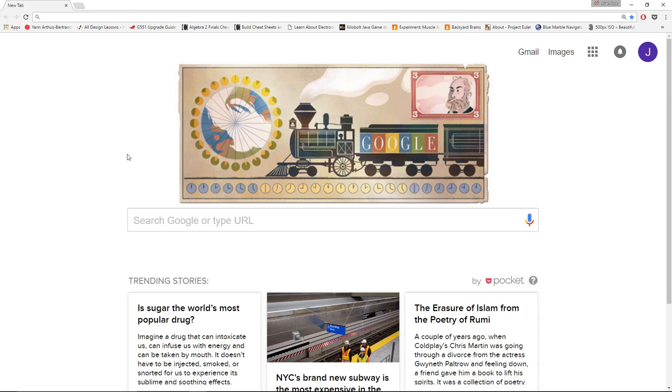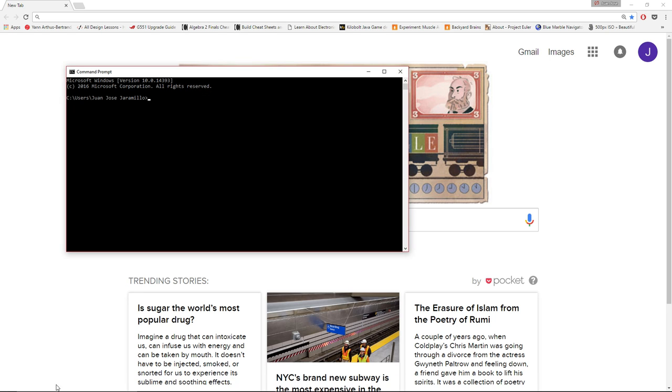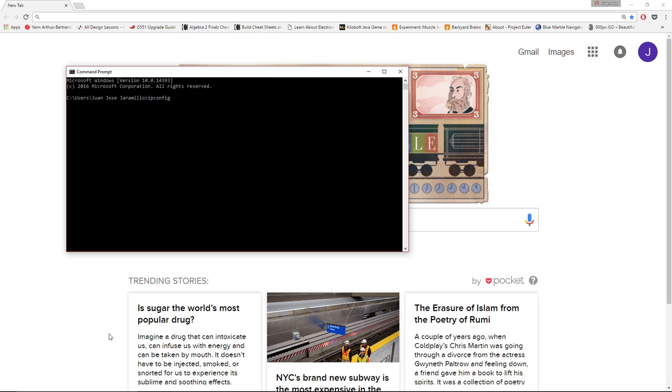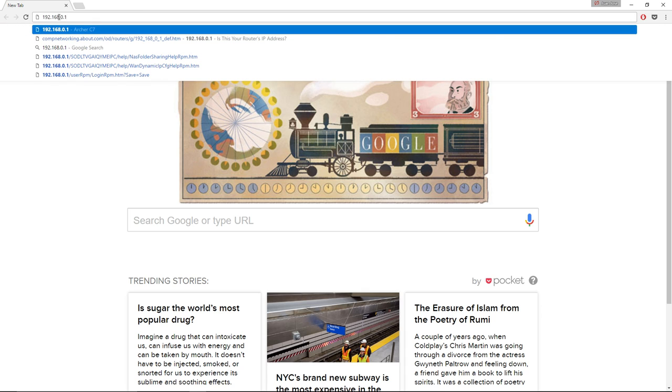Here on my computer, the first thing we want to know is the default gateway. The default gateway allows you to access your router and change configurations. Open the command prompt by typing cmd, press Enter, then type ipconfig. The only thing you want to know is the default gateway number — for me it's 192.168.0.1. It's possible you'll have the same. When you have your default gateway you can use any web browser to access your router.